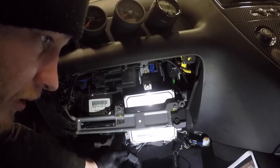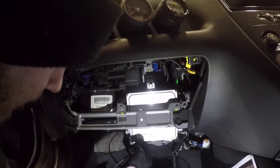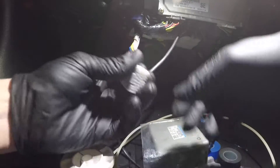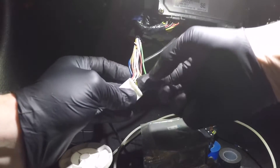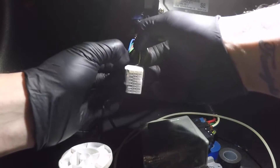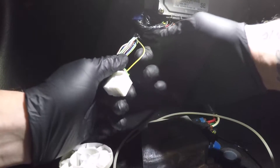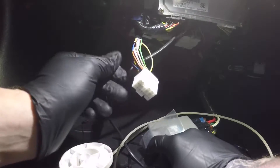If you want to double check them, just pull them out and count the pins — there should be like 30 pins in your A plug and 24 in your B plug. What you're looking for is pin 21, and it's a yellow wire with a blue tracer. Where this goes is to your EVAP canister valve — the little brown solenoid on top of your throttle body. It does control some other stuff because it just says PCS.